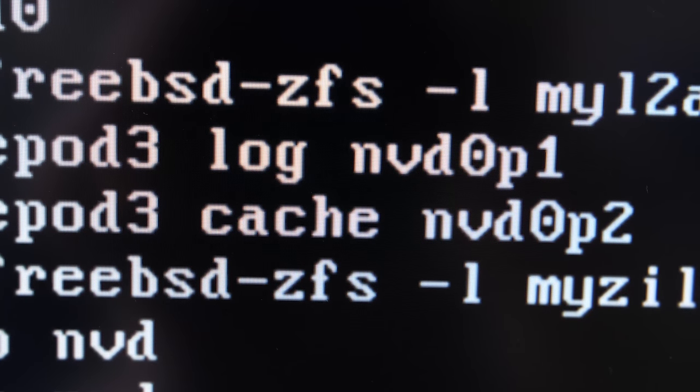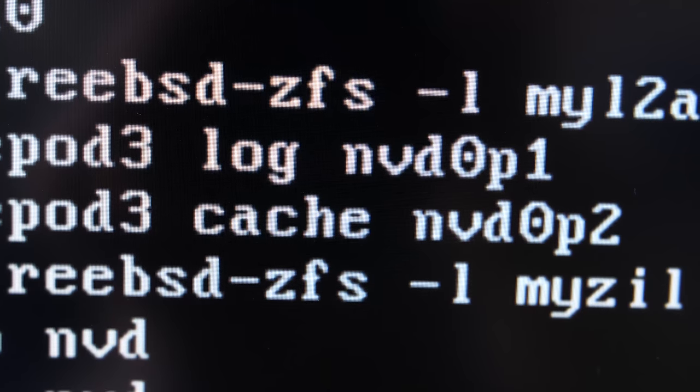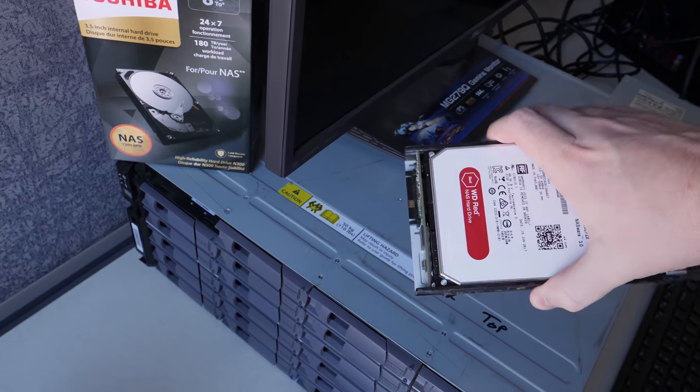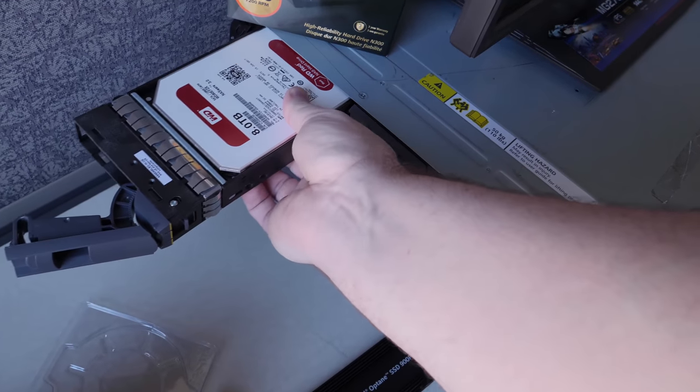So we've got a partition for our separate log, our separate ZFS intent log, and also the L2ARC. I'm not sure if 32 gigabytes of memory is going to be enough for the system. The old rule is that you have 1 gigabyte of memory per 1 terabyte of disk space. And depending on if we add 12 or 24 8 terabyte Toshiba disks, you know, we may be looking at